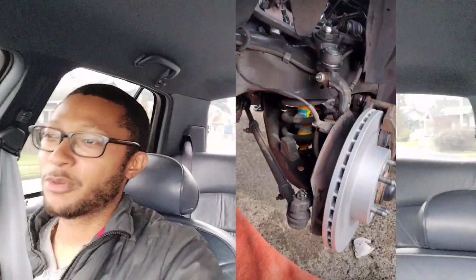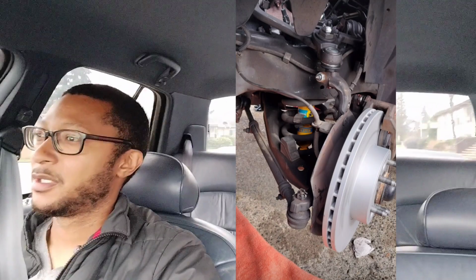A lot of people miss brake fluid. I have a video for that as well. You've got to check your brake fluid. When I first got this car, the brake fluid was green. Every time I was sucking it out, green. So it had been sitting for a while, so it absorbed a lot of moisture and there was algae in the brake system. That's not good. Got to get that replaced. So without me doing an actual 4-wheel bleed of the brakes, I have replaced the brakes, front and rear. So that's another cost, your brake fluid.